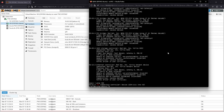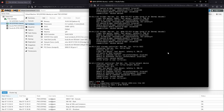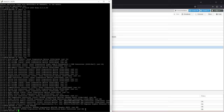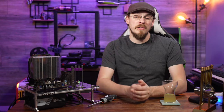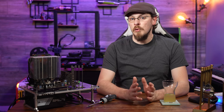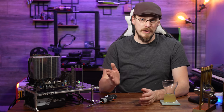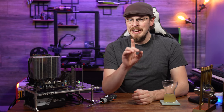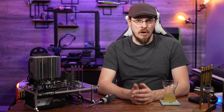The weird thing is, it looks like it wants to work. The VM will fail to start if you have something misconfigured, and it will successfully start if a device is assigned to it — it just doesn't actually pass through the device to the virtual machine. So things like virtual gaming machines with dedicated pass-through graphics cards, or a virtualized NAS with a pass-through HBA, are going to be a no-go on this board.